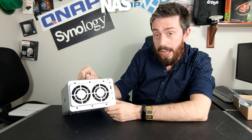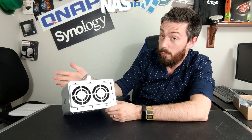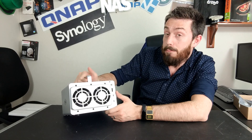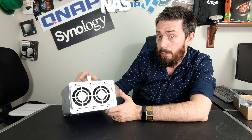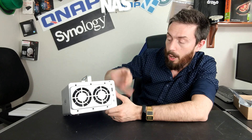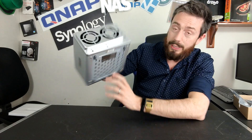Looking at the rear we have two fans that adjust with internal temperatures. The software has a few extra bells and whistles beyond just RAID configuration. Those two cooling fans will keep things cool — they're not the quietest fans, and generally you have to pay a premium for quieter RAID devices. Thunderbolt cables start having latency problems around 3 to 5 meters. The noise level is what I'd expect from something at this price point, around £550–600.